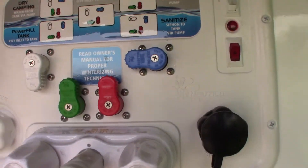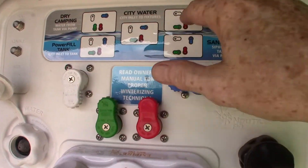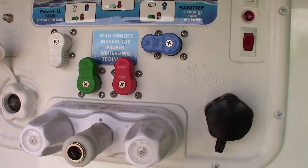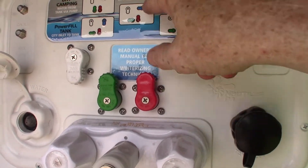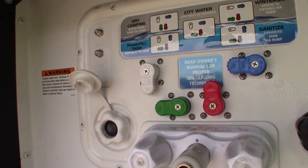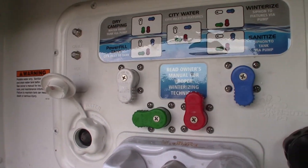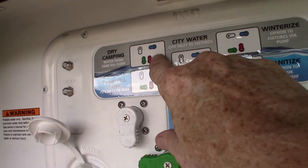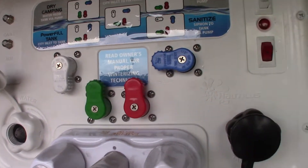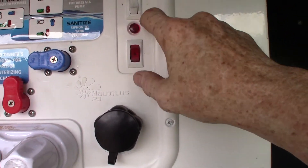This is very typical of water hookups. Basically, you've got four valves, and you have a drawing for each configuration. If you're just going to use city water, you hook the city water hose right up to here, turn it on, and put this into the correct position. If you're camping somewhere without plumbing, you can fill your tank by changing to this position. When you want to pump water out of the tank with the onboard pump, there's a switch here and also a switch inside — just change the configuration and you can draw out of the tank. I'll put it back to city water. You can operate the pump from here or from the inside.